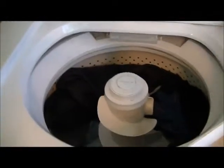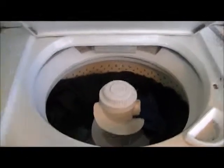On the bottom of the tub there will be two hoses: one connects from the tub to the pump, and the other connects from the bottom opening of the pump, goes through the machine, comes out the back, and goes into the drain — the standpipe or whatever you have.